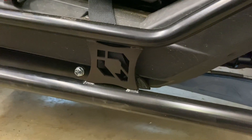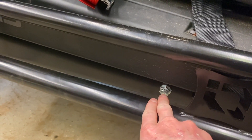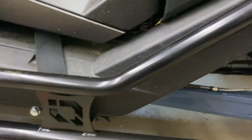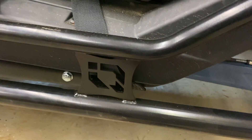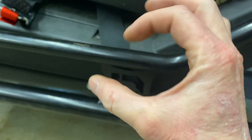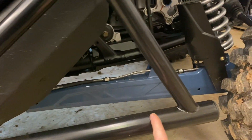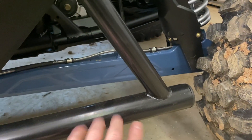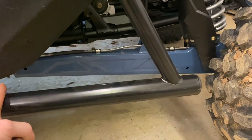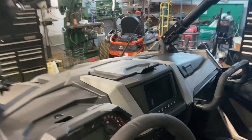On these rock sliders the bolts go all the way through the frame, with a big fender washer on the back that captures the tube. When I torqued mine down I noticed the fender washers mushroomed in a little bit, but they were still larger than the tube so they fit fine. The reason I chose these specifically is they're the only ones I know of that come back far enough to protect you — you've got maybe a hand's width of room between the tire and the slider, and it comes right to the edge of the tire. The other options I saw all stopped short, leaving a huge gap where a tree or rock could catch underneath.